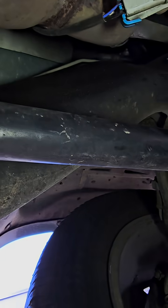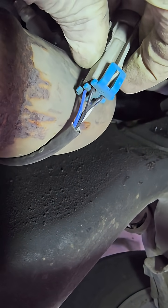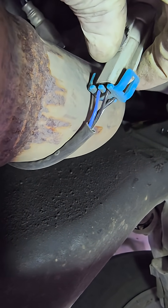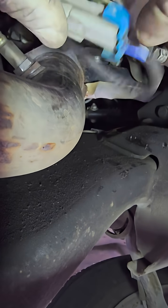Locate your oxygen sensor plug. You see those two black wires — you're gonna check those, as those are your heater wires. Plug that into the car's harness and right back here you're gonna check for 12 volts.